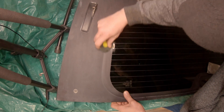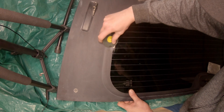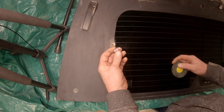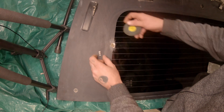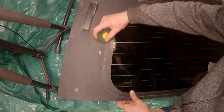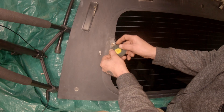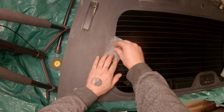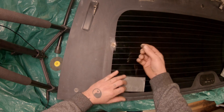Being careful not to cause too much damage — scratching it a little bit isn't a huge deal. I have a tab here that I'm going to try to use; it's got two contact spots on it and I want to place it here and here. I'm just trying to make this spot as clean as I can with the sandpaper without damaging the grid itself. Then I'm going to take my tab and shine up the contacts on it, clean any residue off them — it looks pretty good, nice and shiny.